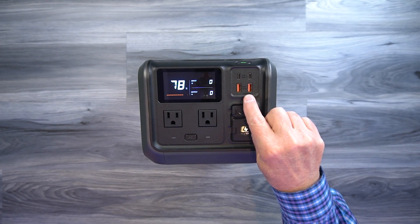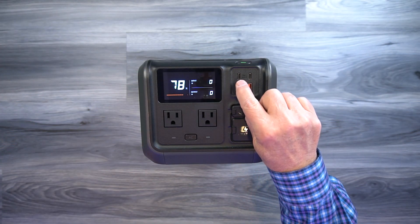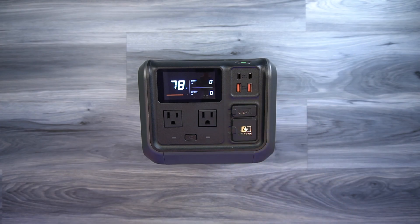You'll also find four USB ports on the front. Two are the older-style USB-A ports, both providing 24 watts of charging power, which is about the highest you can get from any USB charger you own. There are also two full-sized USB-C ports on the front, and both of those can deliver 100 watts of charging power individually. That means you can plug big things into those USB-C ports — large tablets, laptops, portable gaming systems, drone batteries. 100 watts over USB-C is almost unheard of in portable power stations; most others offer 30, 45, or maybe 60 watts. 100 watts means you've got plenty of power to directly charge your laptop.